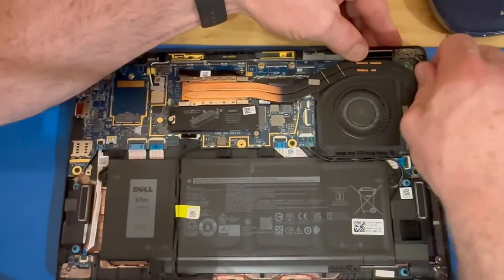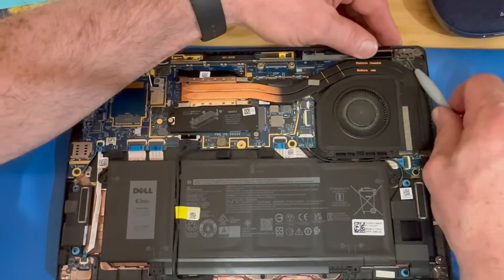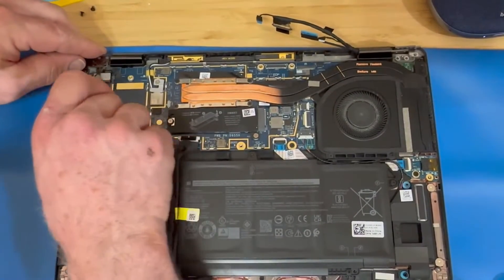But in this case we're working with the stiff hinges. Carefully try not to pry against anything sensitive — no circuitry or anything. I'm prying against the palm rest itself, and I do the same thing on the left side.